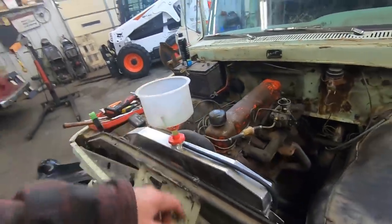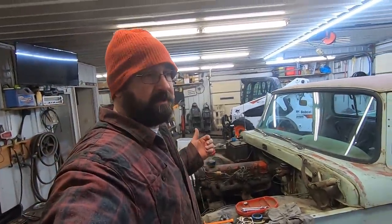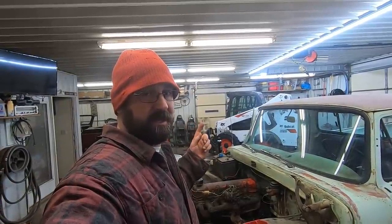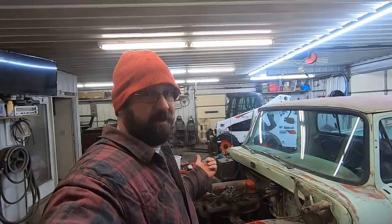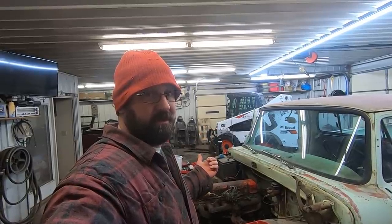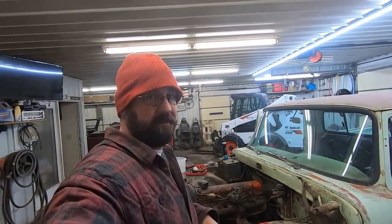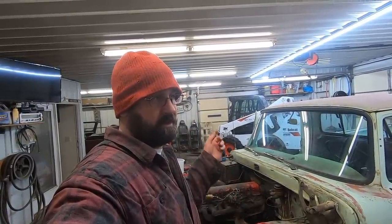So these funnels. All that being said about coolant, when I put something together like this, I usually leave half a jug or a jug of coolant in the cab. So A, it reminds me we should check that coolant, and B, if you do have an air bubble in here and you're out of coolant or it's low when you do check it, you got coolant with you. So after you do something like this, always throw the jug of coolant in the vehicle and run it for a tank of fuel before you put the jug back on the shelf. Your other sweet tech tip of the day from Mortske.